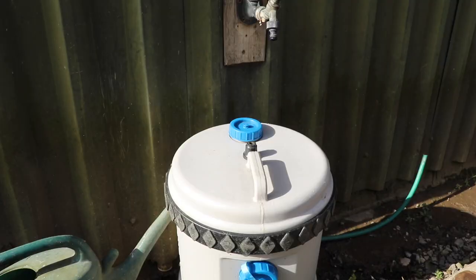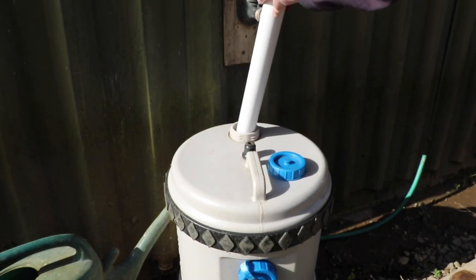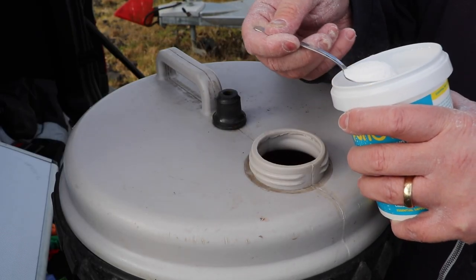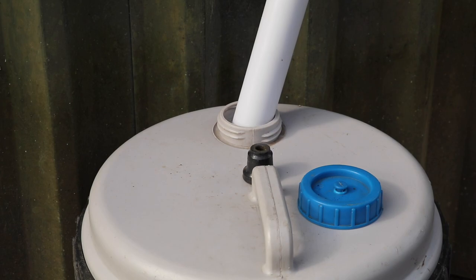The very first step is to fill our aqua roll. We're going to sterilize the aqua roll, the pump, the pipework, and the taps — the whole fresh water system. Fill the aqua roll about halfway, add the PuraClean, then fill it right to the top. The dosage is one teaspoon per four and a half litres, so for a full aqua roll you're looking at eight to nine teaspoons. We go for eight teaspoons and that works absolutely fine. Give the aqua roll a good shake and leave it to rest for a couple of minutes.